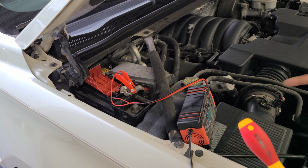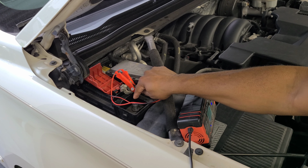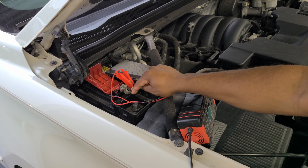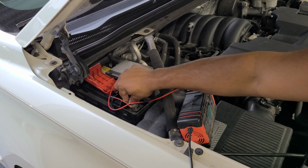Okay, apparently what I'm reading is after you replace that sensor, you need to disconnect the battery cable and give the ECU a hard reset, and they say that should fix the problem. So what I'm doing now, I got the battery terminal unplugged, and I'm about to replug it, seat it up, and of course I'm gonna put the charger on because this car's been sitting up for a while. So now got that back seated. Tighten this back up, and then we'll check it.